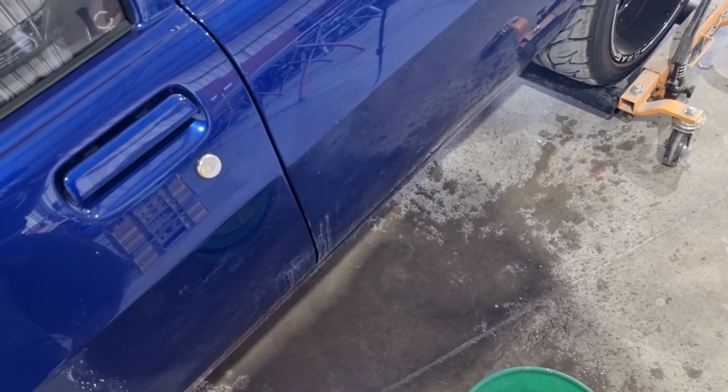So now I think I might take the door off the car and put it on a stand so it's lying flat, and then I want to fill that with base coat until it comes nearly to the top of the chip, and then I'm going to rub it back, and then put some clear coat in the chip and see if I can blend it all in nice and neatly. And my thoughts after that was getting some solid colour, because I did the full firewall in it, getting my airbrush and just going over it with the solid, to see if it blends in nicely.